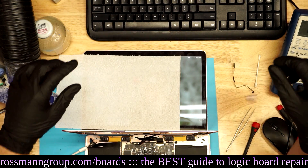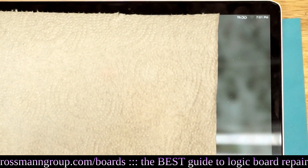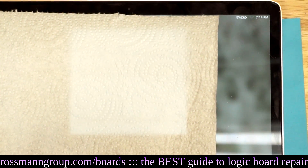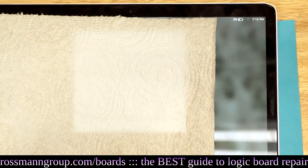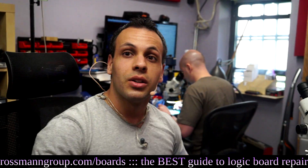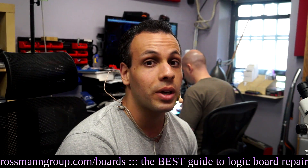It says 1% battery. Let's see if it charges. We started at 1% and we're up to 5%. The way to confirm it's actually charging and not fake charging is to unplug the charger and see if the machine stays on — it does, and it jumped to 6%. It is able to charge the battery and everything works. That is how you fix a machine that was messed up by a terrible mall franchise. That's it for today, and as always, I hope you learned something.